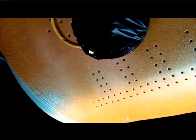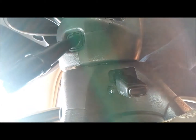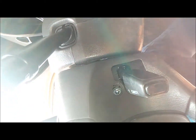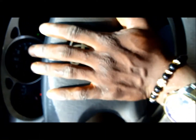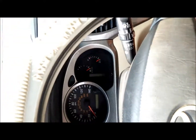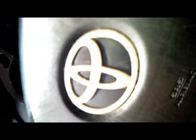So right now I've got to my ribbon and I'll show you guys how to do this. There are torx screws behind, beside the steering here — one right beside the cruise control switch, and also another one here. After you loosen them, you take out the airbag — but be careful, you should first of all have your car switched off, key off the ignition before you proceed. So now I've taken off my screws.